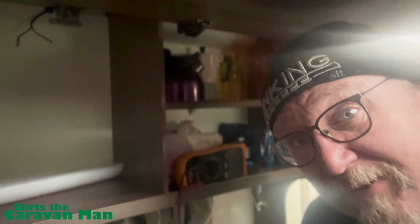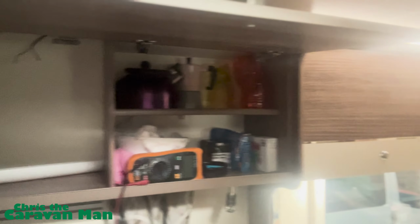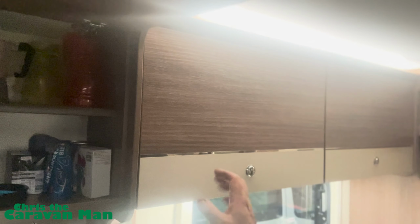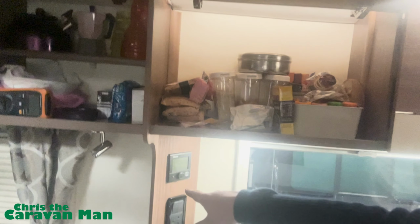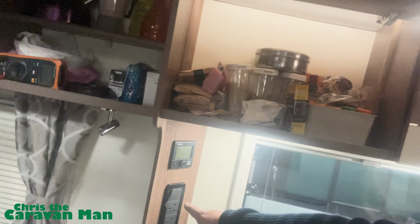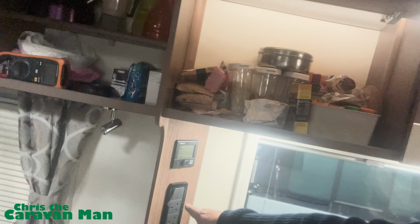Right, cabling is in. As you can see, if I just spin you around, look up there, there's my two little tails up there, plus and minus. We checked it, I've got 13 volts coming out of that, which is quite lovely. So basically, as I said, I've gone along down through here, through that one, down the trunk in the corner, down into the 12-volt feed, which is on the back of one of these lights. Now I've gone for the right side of the switch, so basically if I turn the switch off, it's not going to turn my router off.